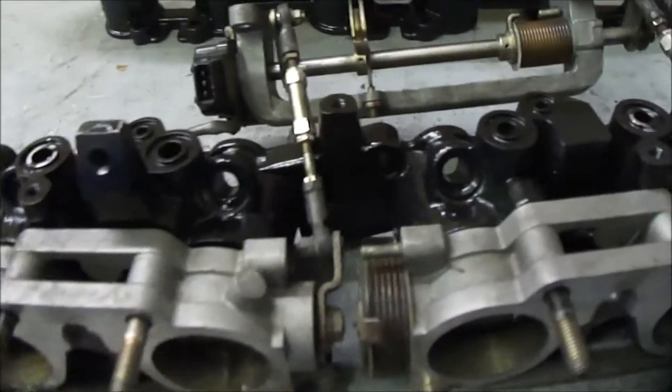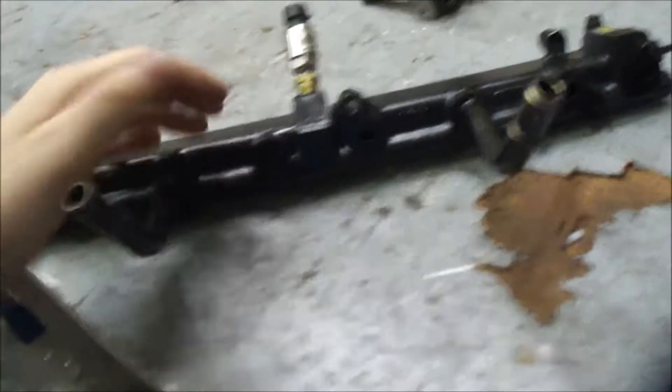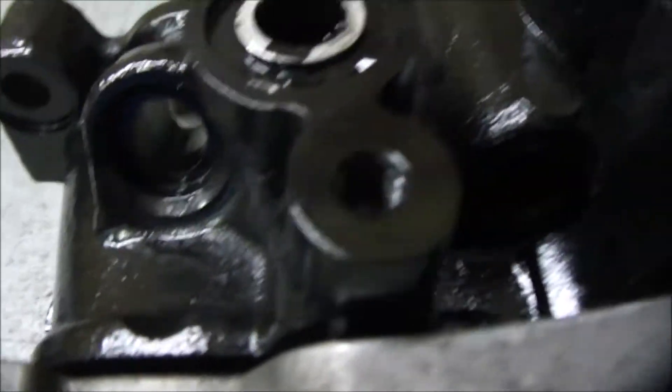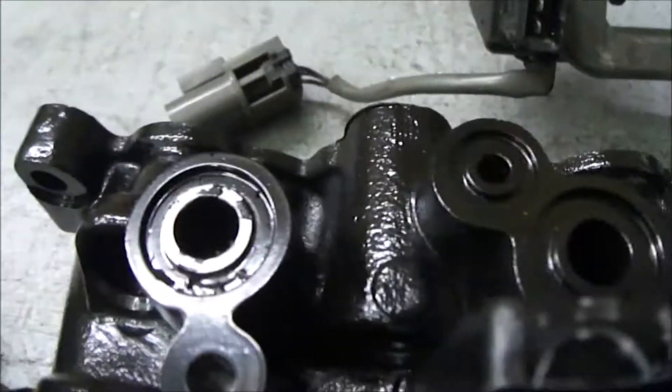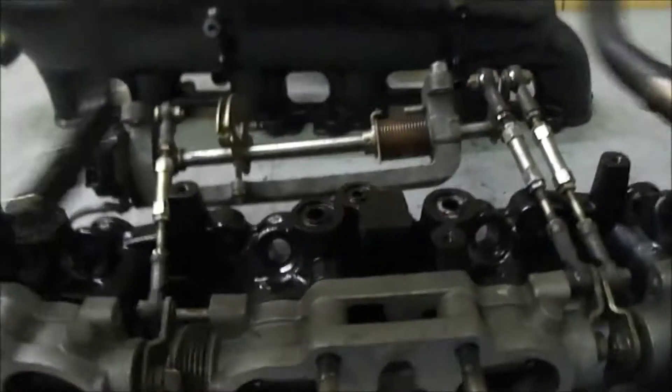Normally that would all be located on your intake manifold, so you have basically individual vacuum for each one of these ports. So Nissan decided to use this, which is a balance tube. You have a bunch of holes that go onto your runner, which is before or after the throttle body. It basically takes a sample vacuum from each port so you ultimately wind up with a normal vacuum. This goes on top, like so, and then these two vacuum tubes go underneath the manifold.